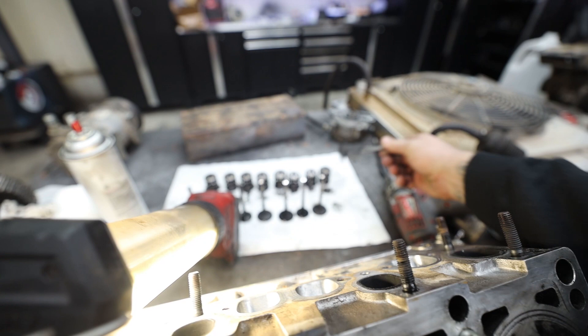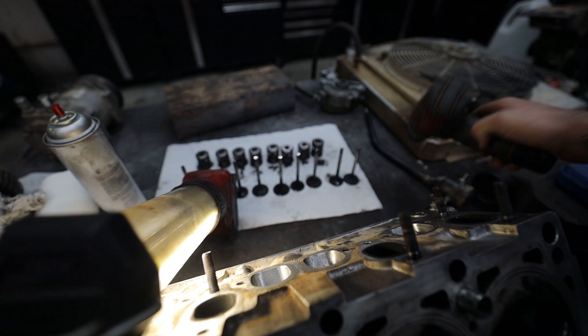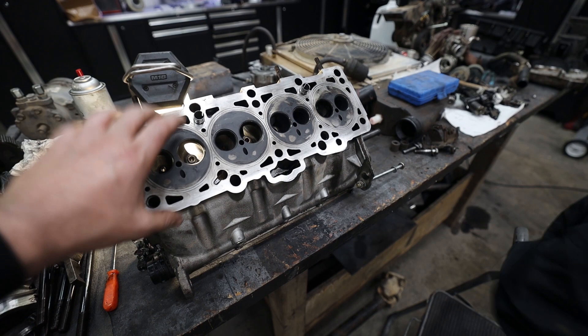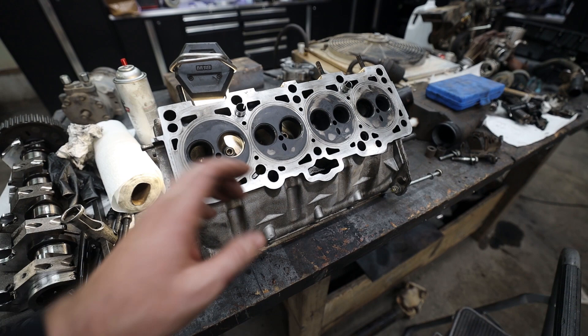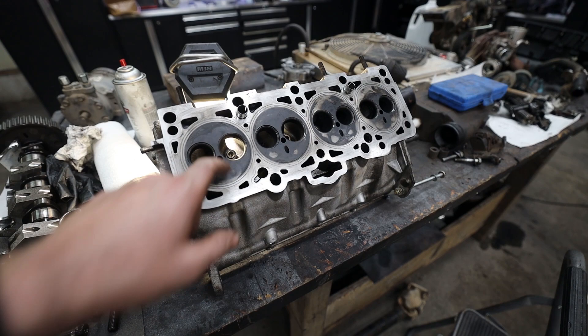I'm going to do an unscientific check that I've seen other people do and it does seem to work. I'm going to chuck this valve in the drill. Usually if you see any wobble — a tiny bit of wobble is probably normal, just because of drill tolerances — but we're looking for a major wobble. Right now I don't particularly think we're going to have any. If none of them wobble and they look good, I'm going to put some time into the head, clean it up super good, and then we'll do what's called lapping the valves. We'll put lapping compound on there, spin the valves really good, and that'll be another way to test if they're bent because we'll start to see uneven wear all the way around.